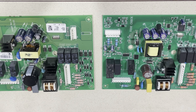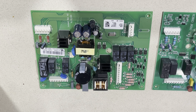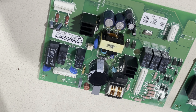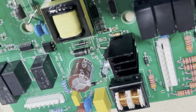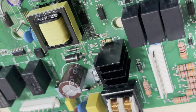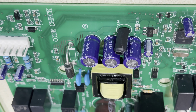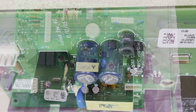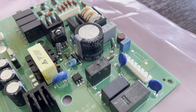Here's a side-by-side comparison of both boards — the OEM one on the left and the replacement I purchased on Amazon on the right. I noticed two differences: you see that capacitor in the center, the brown color, on the aftermarket one. And then the capacitors up top — that one is smaller. Some subtle differences can make your equipment not operate properly.